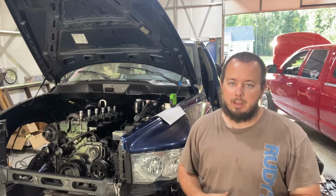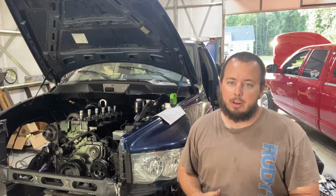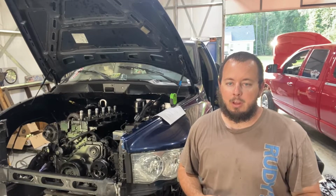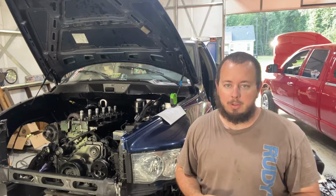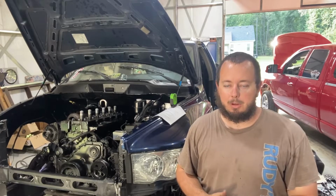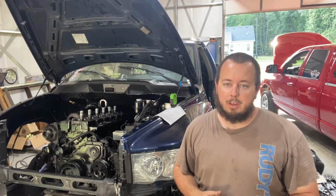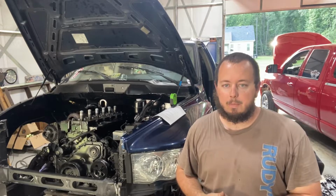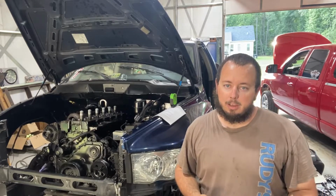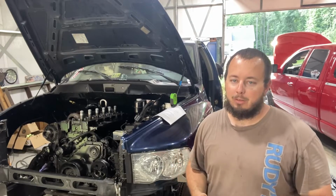The injectors are in, and feed tubes and injectors are torqued down, so that's good to go. As you saw, they're S&S 250% overs. CP3 is installed. There was a broken bolt in one of them, so we had to fight with that, but the pump is in. That's an S&S 12 mil pump for now. So anyways, fuel system, we've got to hook the lines up, but it's ready to go. And hopefully next time we're together, we'll be firing this thing up. So it's getting really, really close.